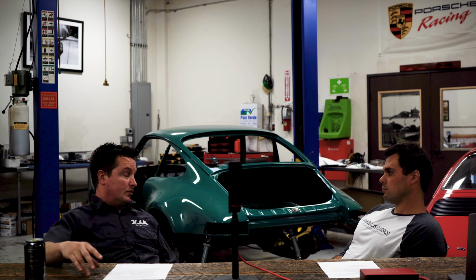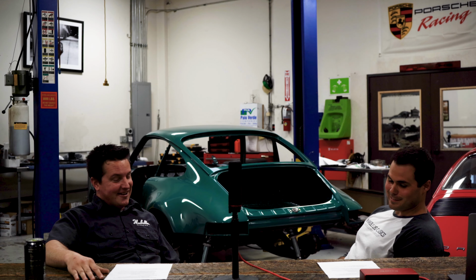It gives you more room. Plus you have a stock mounting place for the fuel pump. So with a larger engine, you're going to want a fuel pump in the front. So there are a number of reasons why it's better to go with those, but lightweights. And it's pretty, so, I mean. It looks good, as long as it looks good.